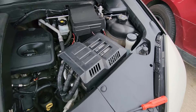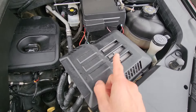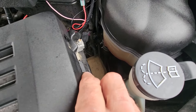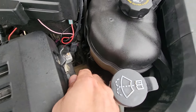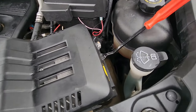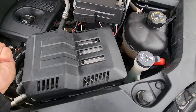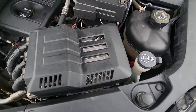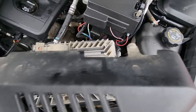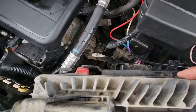The first thing you want to do is remove the black cover from the PCM. This cover slides to the right — that's the only way to remove it without breaking it. To slide it, you first have to push on this black tab to lift it over, and then you can just slide it over. I had to use both hands, pushing my tool here to get it over, then pushing the cover to the right to remove it. These plastic tabs sit inside these slots, which is why you have to push it there first.